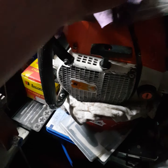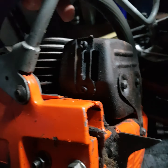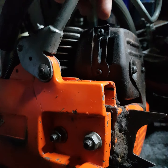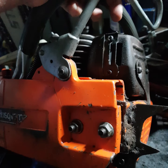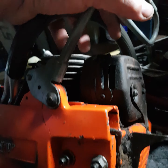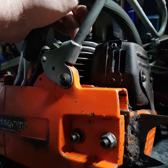It's going to be a good project, this Husqvarna 61. It has this muffler - I'm not very fond of it to be honest, it's quite restricted. I have a couple of replacements that are hollow with just a round outlet pipe, so I'll see how that will fit. I believe this piston, judging by the studs, it's a closed port - no, it's an open port.